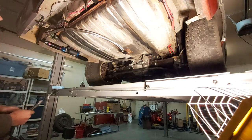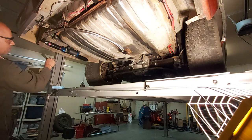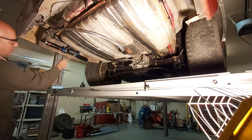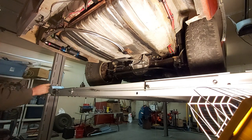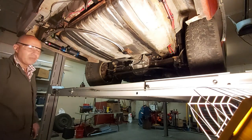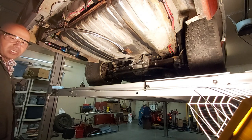Fuel line from tank to pump is done. There's the 100-micron pre-filter, the number 10 line, and then pre-filter, pump, and post-filter all installed. Next is running the lines to the fuel rails of the factory truck intake manifold.